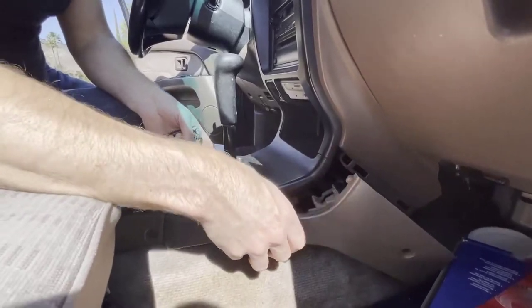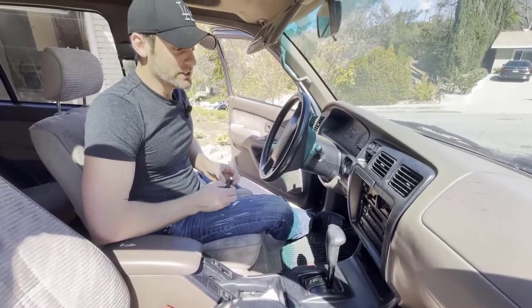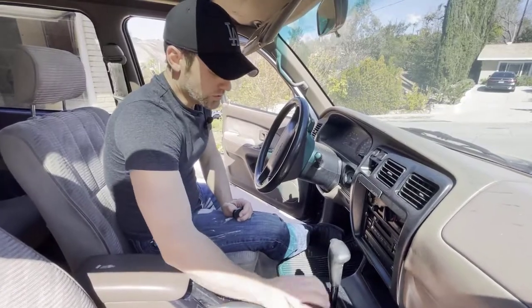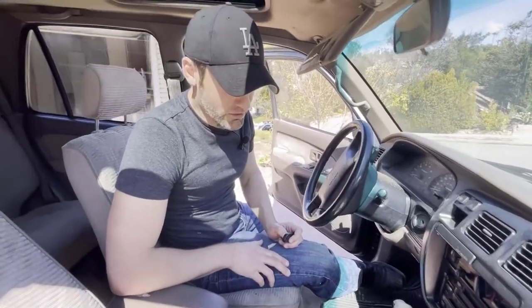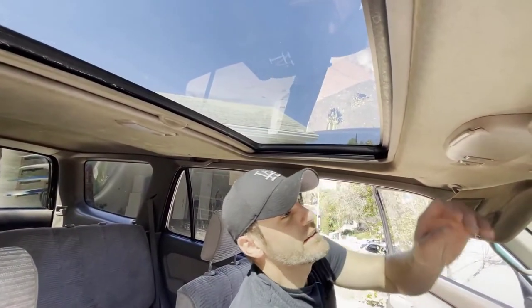What I plan to do is actually strip out all of this stuff completely out of this car, clean it, and see what needs to be replaced. The actual carpet in the vehicle is pretty dirty — you can clean it, but it might be cheaper on this vehicle just to replace it. If I try the sunroof, I can hear the motor wanting to work but I don't think this is gonna work, so we'll need to figure out a way to fix it. A lot of times the cables on these motors just get old and seize up — that'll be a good video too.